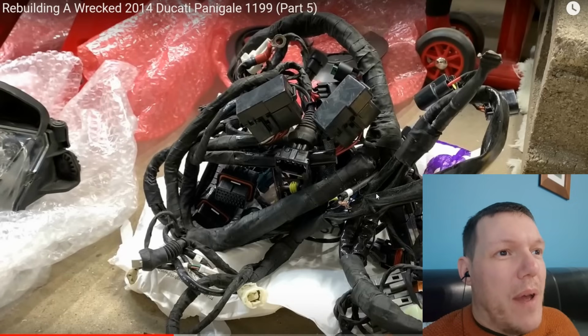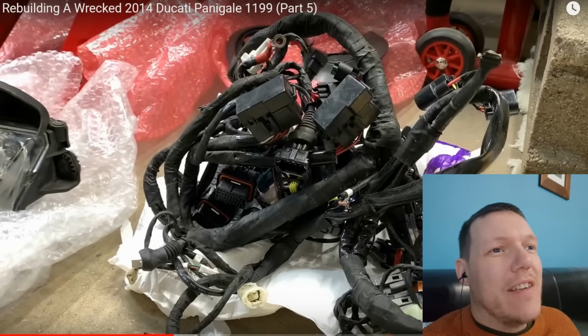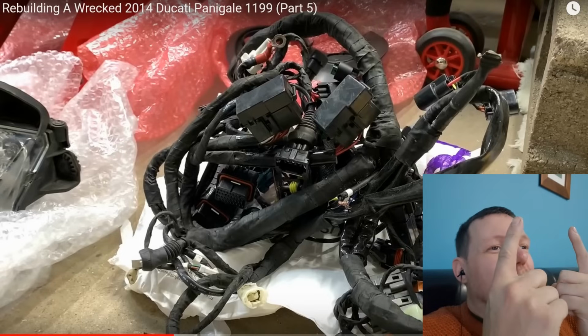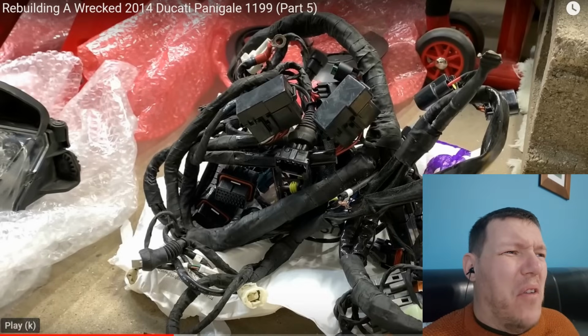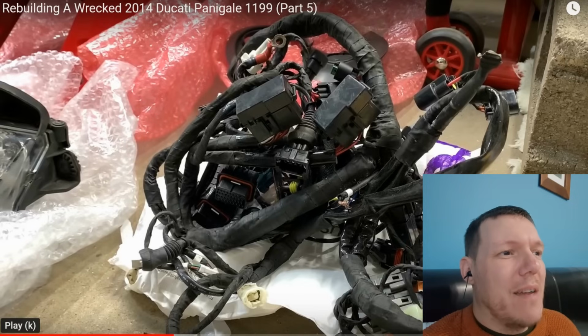And then do the repair, because you have to splice them on anyway. Please don't cut, because now you've got one knackered loom and one good one. You're now going to butcher one good one to put two connectors on a bad one to make it work, and now you've destroyed a perfectly good loom. Not for just two connectors, and not if they're not specialist connectors, they're indicator connectors. You can get them bloody everywhere.